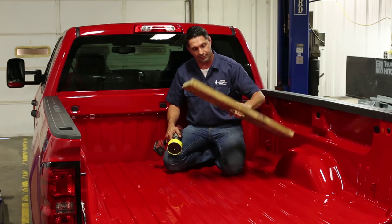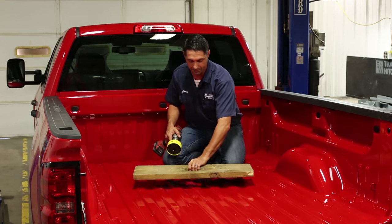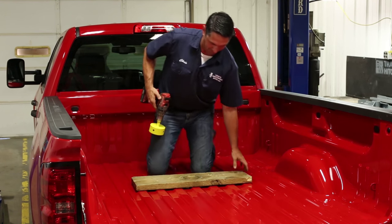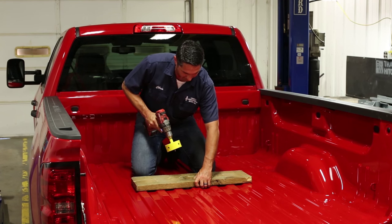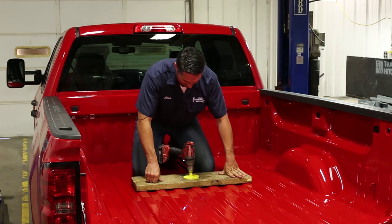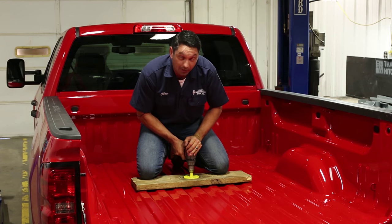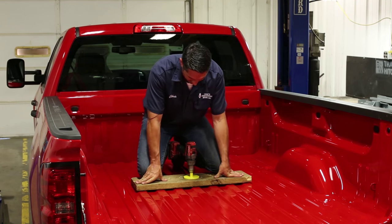One method is to take a piece of lumber like a 2x8, 2x10, or even a thick piece of plywood, have a circle already cut into the board with your hole saw, and then line that up with your pilot hole. Place the arbor down into the hole, put your knees up on the board, and the board will actually help hold the saw into place and give you a nice clean cut without the saw walking around.